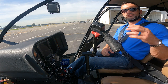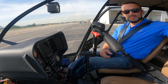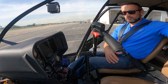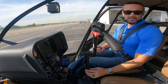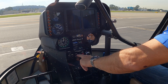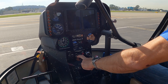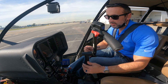Cycle through the rotor brake — on and then off. Worth noting that Robinson helicopters have fail-safes: the engine simply won't start if certain things are still engaged, and the rotor brake is one of them. The clutch is another — you don't want to try to start the engine with the rotor brake on. Make sure the landing light is off — it's on the center of the cyclic on the 44. Always check that the clutch switch is down: down is always off. The guard can be open while the clutch is still engaged, so always verify that switch is down before starting.